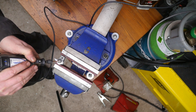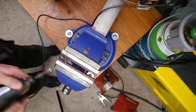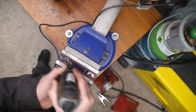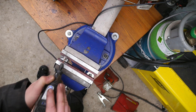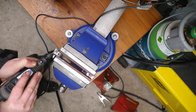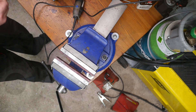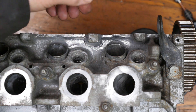Make sure you wear protective breathing apparatus — a mask at least. Quite a lot of powder was coming off that. I used soft jaws in the vise so I didn't add any extra damage to the lug and give me a problem with it fitting back into the original place. So I think that's looking pretty clean now.